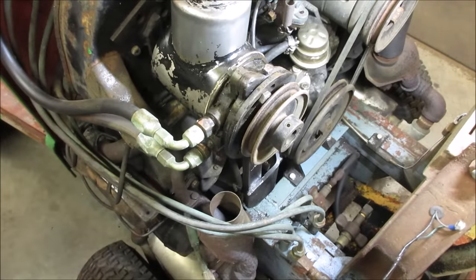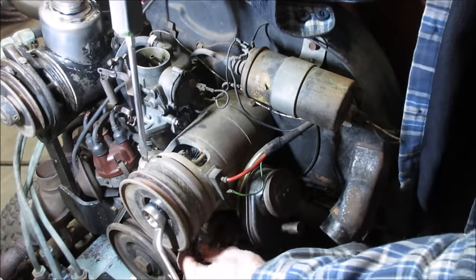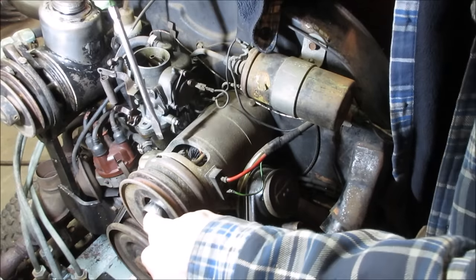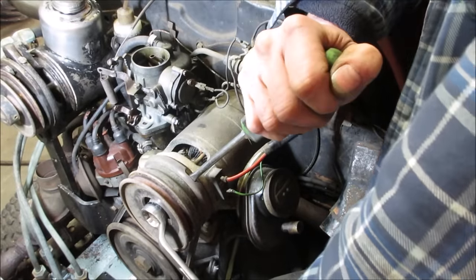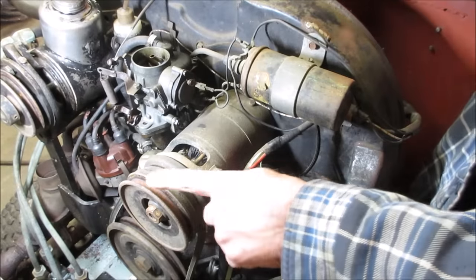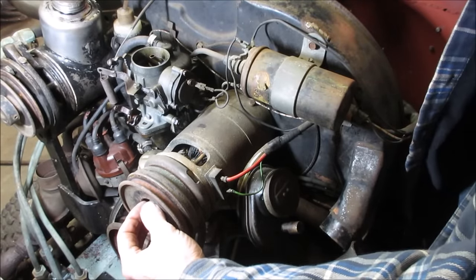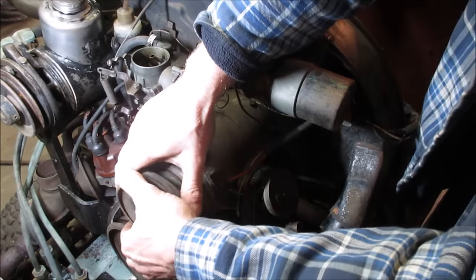One off. So on a regular Volkswagen setup, there's shims to adjust the tension. This generator does not adjust like that pump did. So you gotta take shims out and put them from side to side. But to get to them, you normally take it apart like this. Let's go see how that homemade pulley was put on there. Just throw that anywhere.